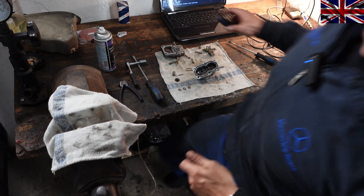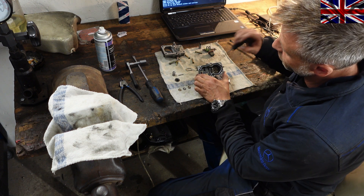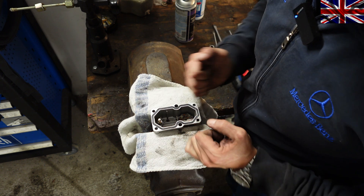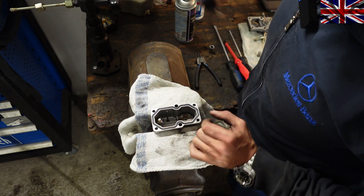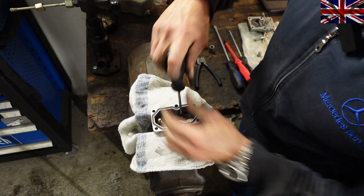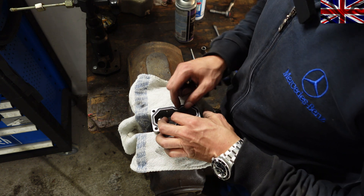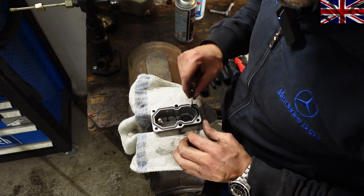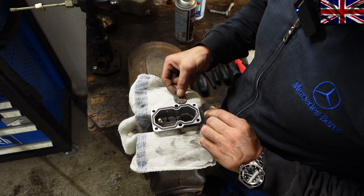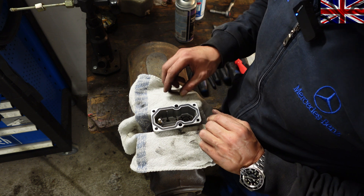The control unit is sitting right here. Screws are always tight because dirt can enter from the other side — I had to use a vise to hold the upper half in place to eventually remove all four bolts. Once I remove the plate of this control unit we can tell more about it. Membrane repair kits are available to replace broken components, but for the time being this one looks quite all right — very little fuel gunk. The plate also looks quite all right — I'll just give it a wipe and that's it.